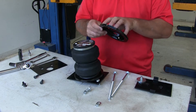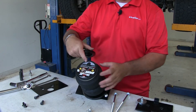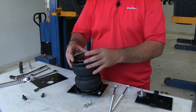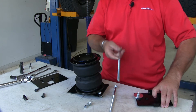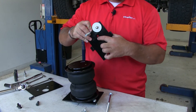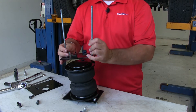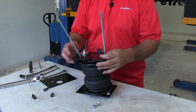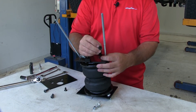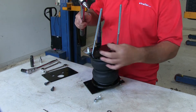On the bottom side of our bag, we're going to have our second cap — make sure the cup side is facing down. It has a large hole; I usually line it up with the cutout and the sticker. As long as you have the two holes lined up to put the hardware into the bag, it's just fine. Take the two long carriage bolts, go through like this — make sure the threaded side is coming out toward you. Take two short flat Allen head bolts and thread them down through the plate. Once they're in, torque them to the specifications in the instructions.